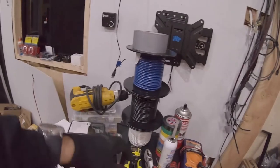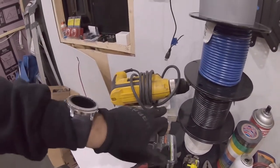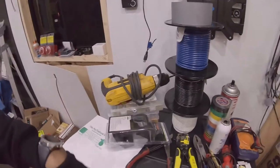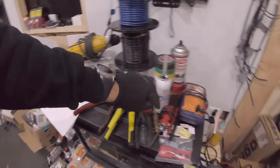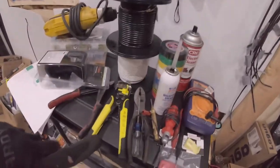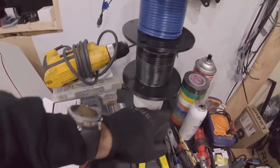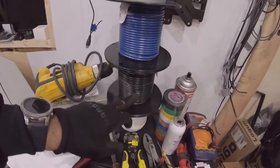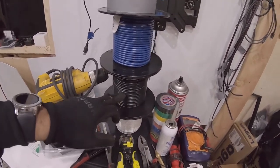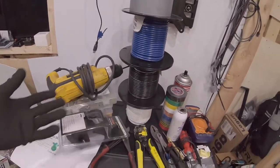These are all 10 gauge. So you'll need some additional butt connectors or some splices, and wire cutters, strippers, pliers, a screwdriver, and a center punch right there to mount the seven-way. And I have electrical tape. These are just in case I need to make some tracers so I know where wires go. Like if you have two black wires running next to each other, it's good to just put different colors on them. It helps you find them later on if you need to.